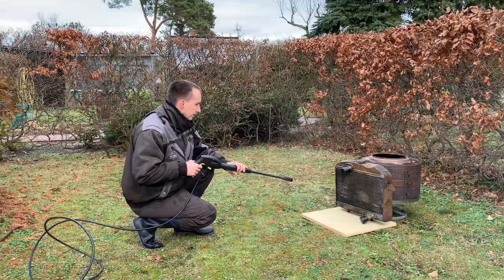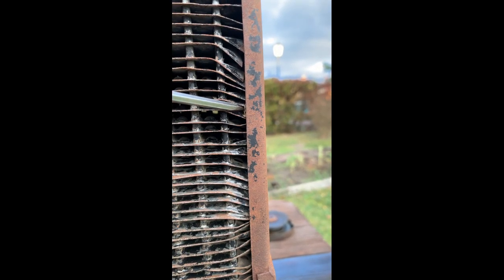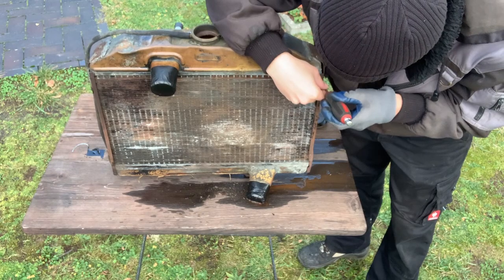All of that is just dirt — I'll very carefully clean this and brush it and it's gonna be nice again. I even want this metal plate straight again; I hate it when they are bent on radiators because you get less air through and worse cooling, and it just looks bad. I also want to show you these little round elements in the horizontal fins — they create turbulences, shuffling the air and mixing it for better cooling performance.